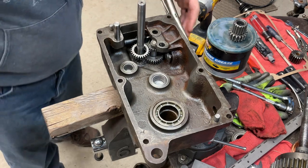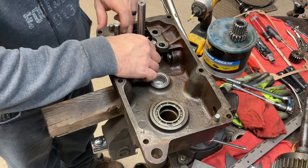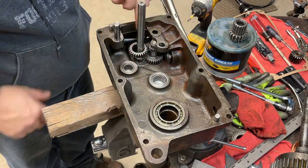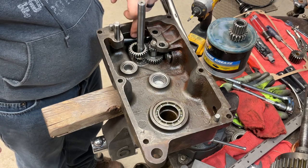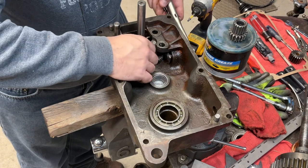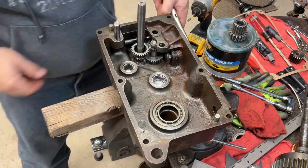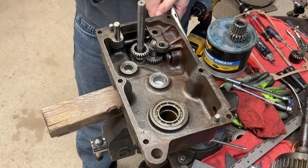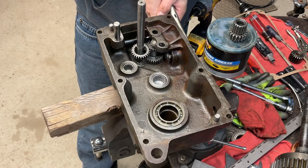With a vice grip on the shifter fork. This gives you an example of how this moves up and down. So the fork is actually oriented in a way where the spring tube points down, and this is not concentric with the gear cluster at this point, but it shows you the detents, low and high, right?